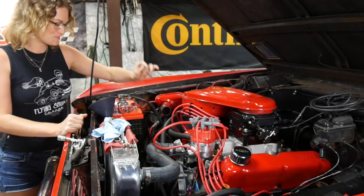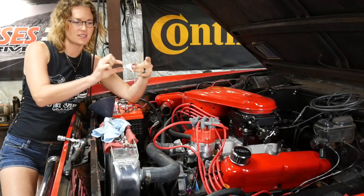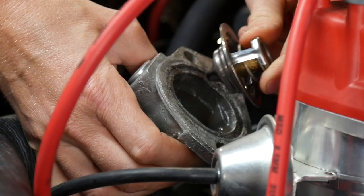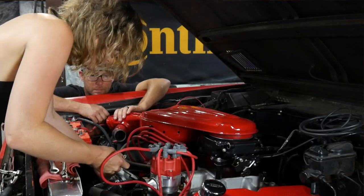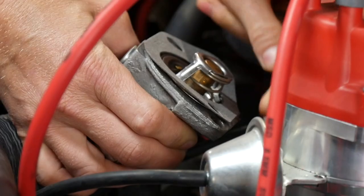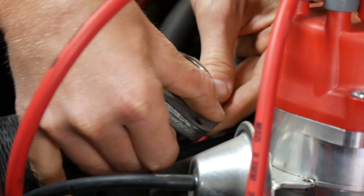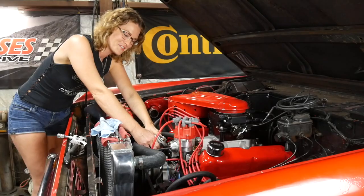Back in action, good morning. We think we have a gasket that's going to work. There is this paper that comes on here that's sticky so you can stick the gasket, but I think I did it wrong when I initially installed it. This water neck has a provision for the thermostat. I think I had the gasket and then the thermostat instead of the thermostat then the gasket, so it never seated properly. Now we're going to install the thermostat into the housing and lay the gasket on top to hold the thermostat steady in its channel so it seals up to the intake and doesn't leak.